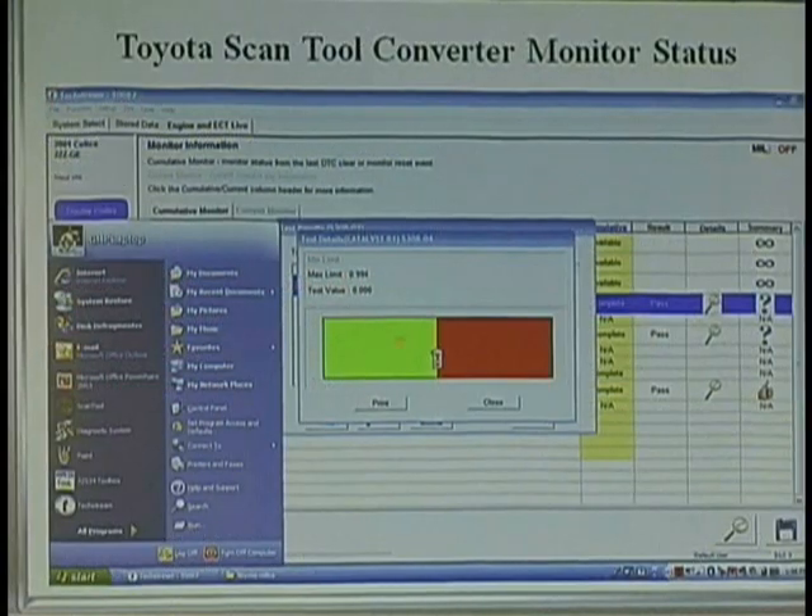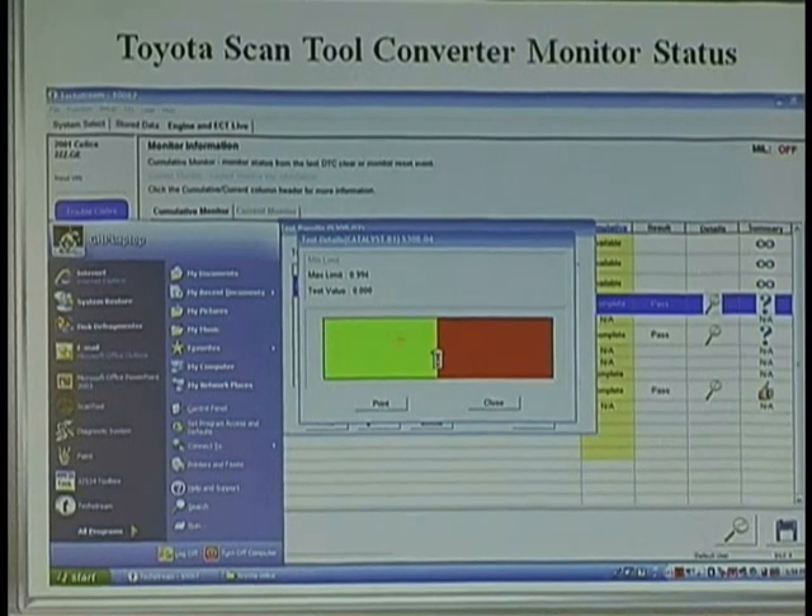That monitor is going to fail something, but it's also good if a monitor won't run. For example, if this is real close to failing or in the failing range and you're trying to get that monitor ready, it ain't going to go — it wants to see it somewhere in the green. I'll give you another one I've seen on a lot of Mode 6 stuff: if it's too close to the very lowest number, it flags it as may not be right. Why? It's too good.